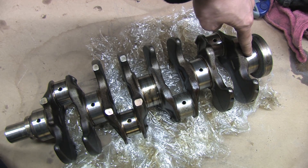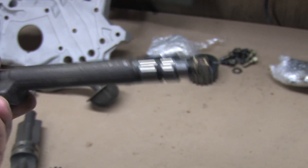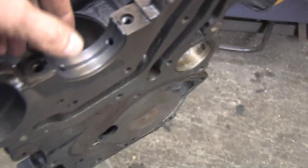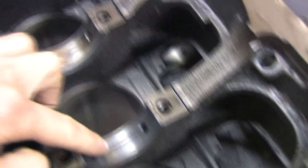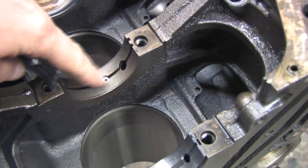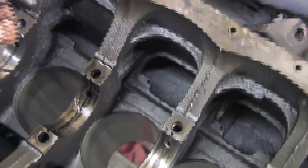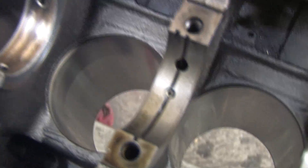The No.5 journal is a little different and we'll talk about it in a second. The rear balance shaft also does something similar, but the path it takes to get there may come as a surprise. You'll see on the main bearings that there are two oil holes in their faces and a groove to deliver oil to the crankshaft. There's also a groove below the bearing to deliver oil to the secondary oil holes on each bearing's face. There's one oil supply for each of the five mains. On a 2G, the oil squirters that aim at the wrist pins for the pistons come from this groove after the main bearing is supplied — that's the squirter pressed through and fitted right there.